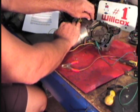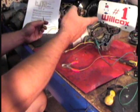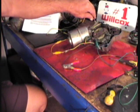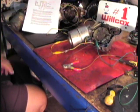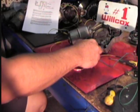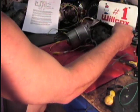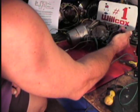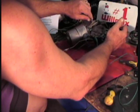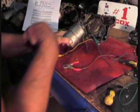That's both the inner and the outer terminals grounded. You'll notice that it parked — so there's your low speed. If you're grounded here with the motor running in low speed and you have a problem with your blue wire, I'm going to have to hold the motor because it's going to walk away. But if you have a problem with the blue wire, what's going to happen when you disconnect the ground is kind of funny — you end up in what we call wiper motor run-on.